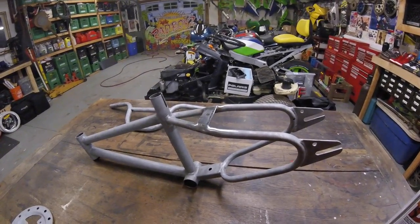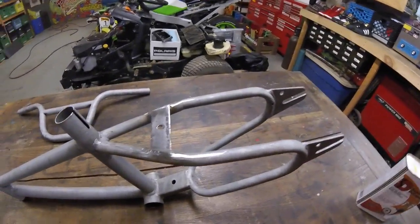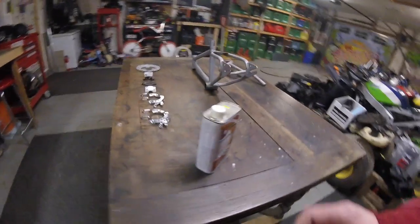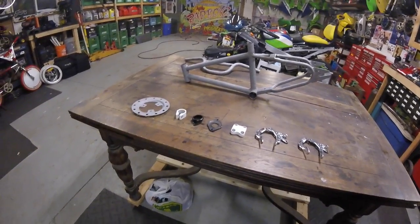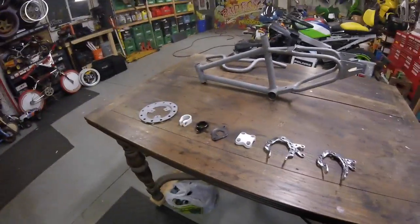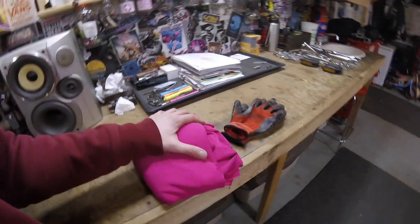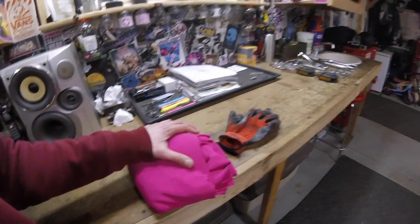So I sandblasted the frame and fabbed up a new brake bridge out of leftover material from the shop. By the time it's painted, no one will ever know it wasn't on the bike from day one. This is a freestyle bike — it has to have front and rear calipers — and it had no brake bridge or mount point, so I created my own. This project is coming along well, and I just need to get this stuff painted and wait on a few more parts.